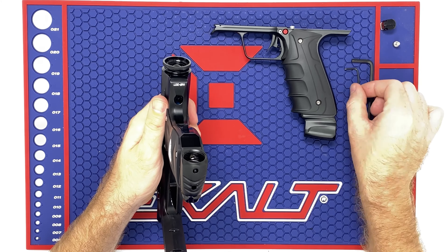Remove the screw and set that to the side. The way this frame works is it actually pivots from the front. I'm going to hold the gun and spread this apart with my fingers, so that way it pulls down and pivots straight down — be careful with that. Then pull it straight off the gun. There is an O-ring here but it's locked in place, so you're okay. Now go ahead and take off this front knob. Take your finger and push it from the inside on the pin to help it come out, then unscrew it all the way and lay your electronic frame off to the side. The O-ring is inside the on-off knob, so don't worry — you didn't lose anything.